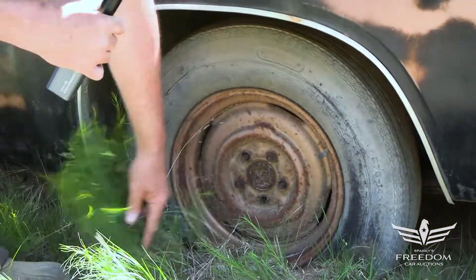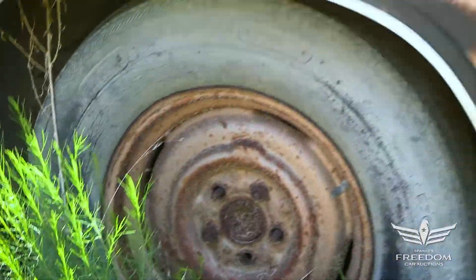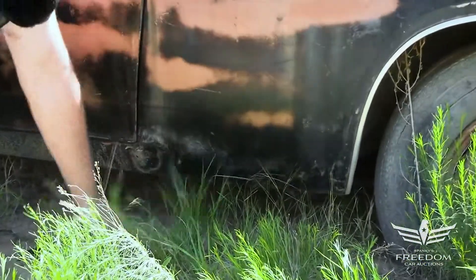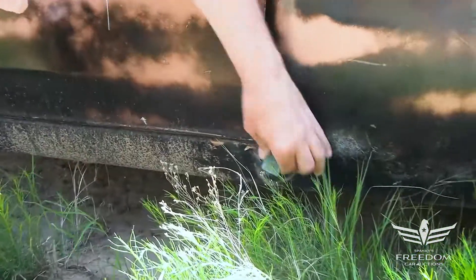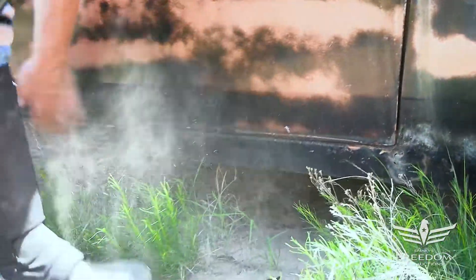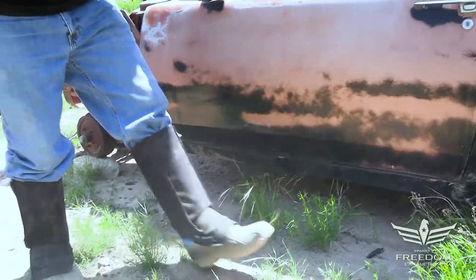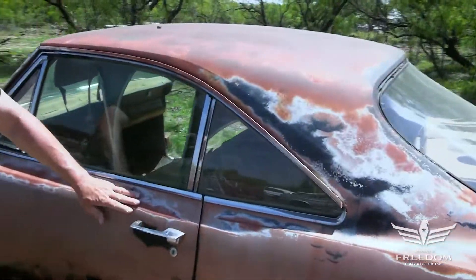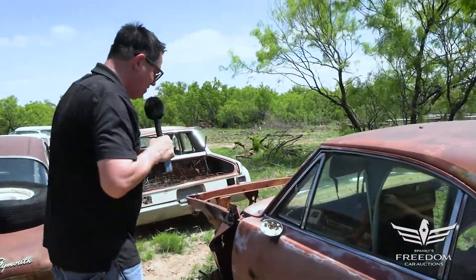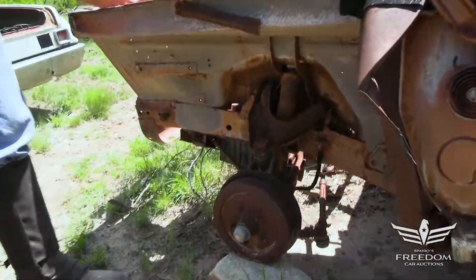The rear axle is going to be the seven-and-a-quarter — the little guy — the Valiant axle with the small bolt pattern 13-inch rims, which is all standard Barracuda stuff when you're talking six-banger. Quarter panel down here looking really good. There's a little bit of filler here, but that's probably the factory bodywork where they join the quarter panel and the rocker. The rocker is nice and solid — the magnet sticks all the way along. On this side, nine-inch drum brakes, standard equipment with the six-popper, and again a beautiful inner fender.